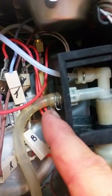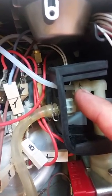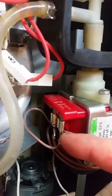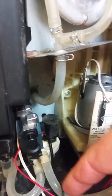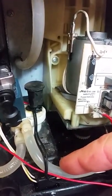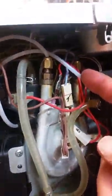Take off this clip here, pull that clip out — actually leave that one on. Follow that hose through, pull out the other clip. Don't lose the little O-ring in there. You've got a couple of little electrical connections there, and you can pull this silicone hose off. Put that in a cup of water and aim it out of the machine after you've got the covers off.